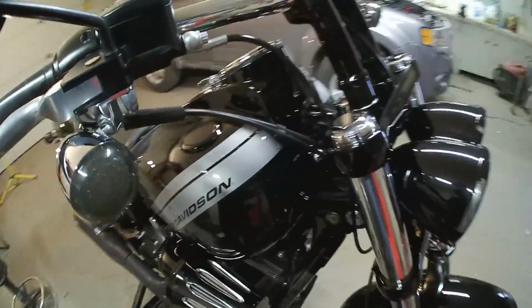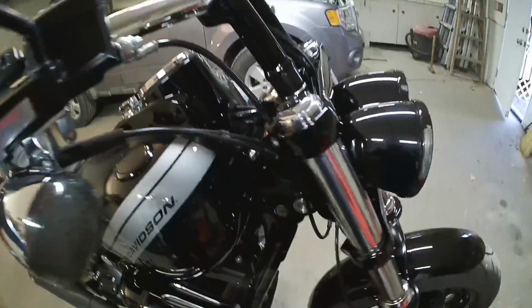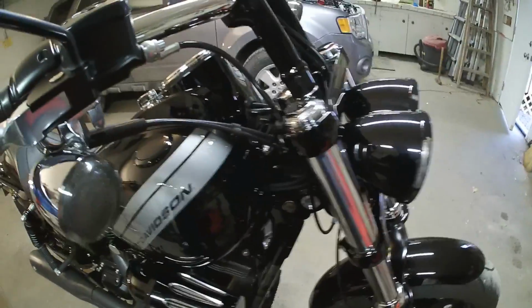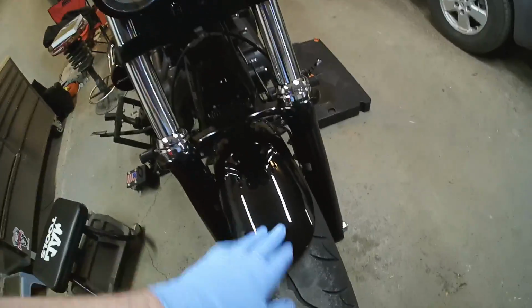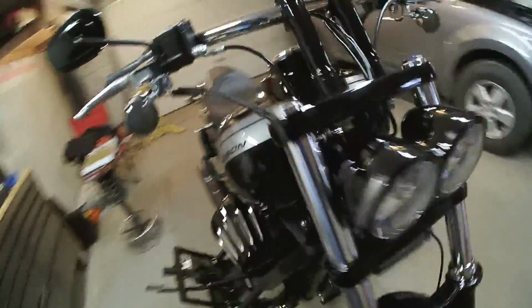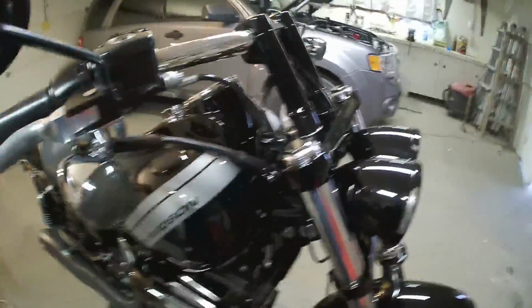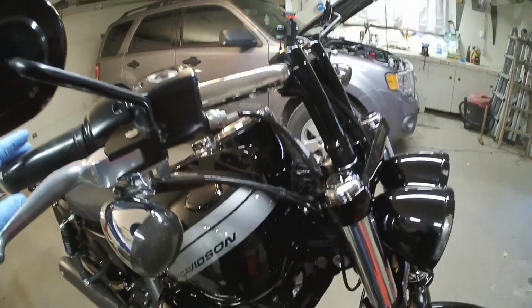Nobody knows your bike like you do. While I was on my trip, I knew that my steering was loose. I could just feel it. So if you know it's loose, you've got to tighten it. I've read online that these fall away measurements are a foolproof method to ensure that your bearings aren't loaded. Because when it comes to a taper bearing, you don't want to have load on it. You want to have it at zero lash.